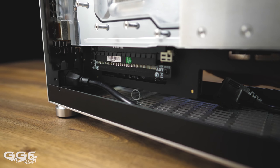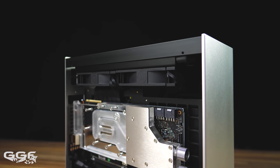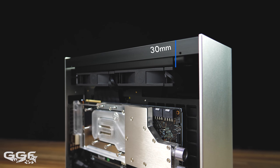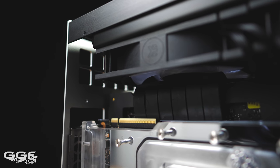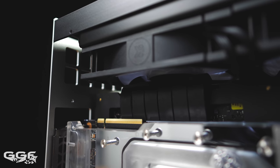Then with the slight gap under the motherboard was my return line back to the other side. For general radiator support in the Sun Milo T03, you're looking at a maximum of 30mm thick with standard fans. There is a fraction more room, but once the GPU riser cable runs over and GPU power cables are connected, it starts to get tight.